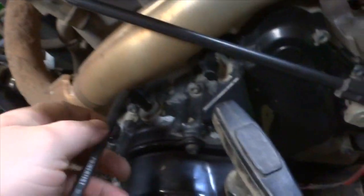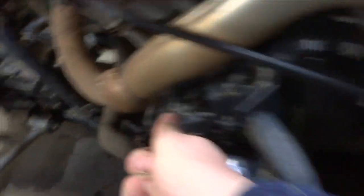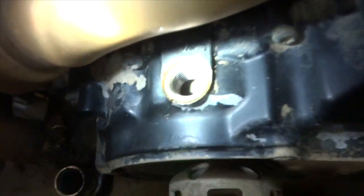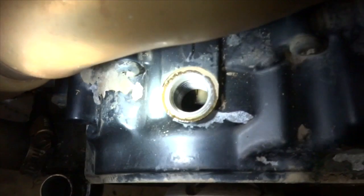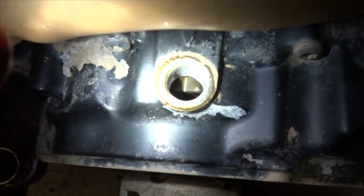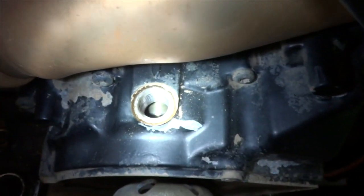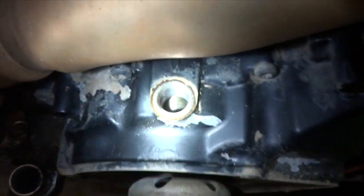Spark plug taken out — cracked this sucker open. Holy shit, that thing's retard tight. So in order to ensure that it's top dead center, if I shine it in the hole here, you can see there's a line. Shine it in your piston and your piston should be at the very top, because you don't want to do your valve alignment if your stroke is on the bottom or not on the compression stroke.